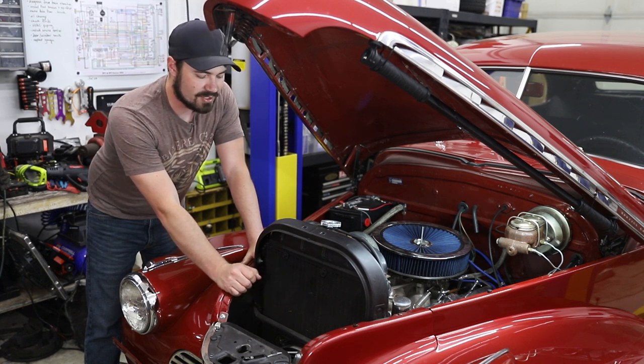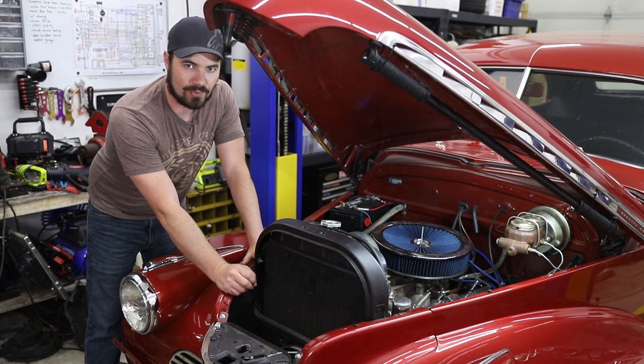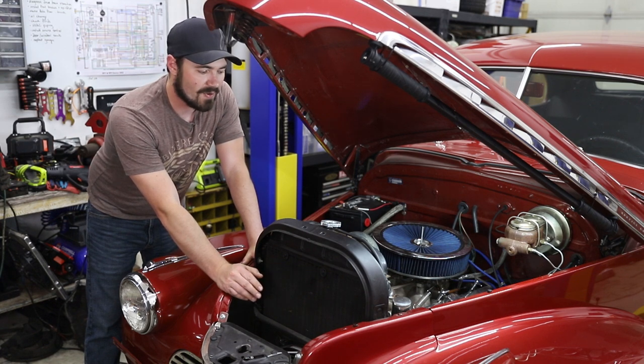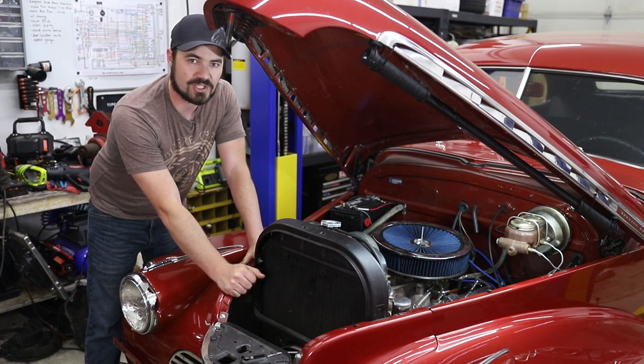I'm going to reuse this if possible because it's already here and jammed through my radiator, but also because I'm not that concerned about exactly what my temperature threshold is for this trigger. I just want something to trigger, and as long as it's below 210 degrees, I'm pretty fine with it on the Chevy 350. It's not that temperamental of an engine, and it's not a race car. If I wanted more performance out of this, I would want my fans coming on much lower to keep the temperature cooler, and if I wanted some efficiency, I might actually want it to get a little warmer than this.